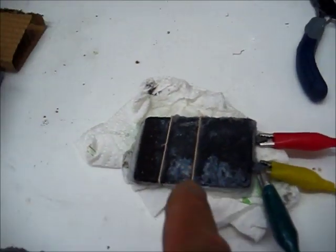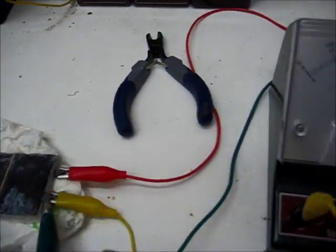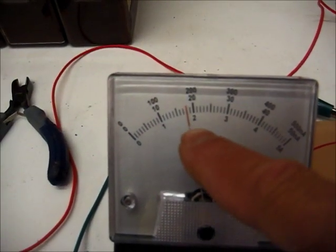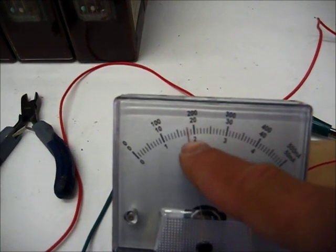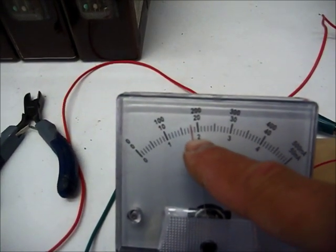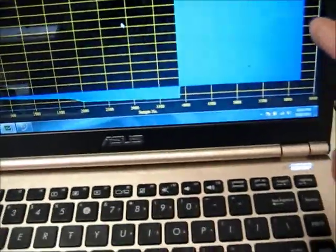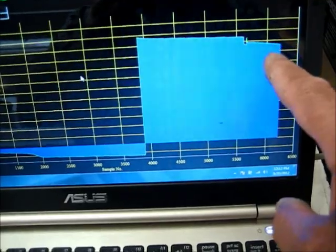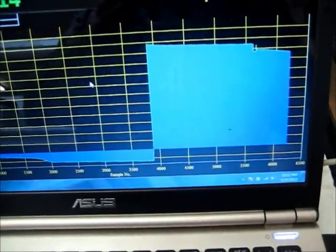Anyway, I want to come back to this real quick. This battery that we made — I showed you in the beginning where it's forming. This is what it's doing — 10-minute charge after the sulfation is driven off. And this is why I'm trying to find a chemical mix that's very safe, that can sustain this power ratio. And this hasn't dropped that much in 20 minutes. But it's going to follow the same crystal curve down. So I'll be back with the other battery as soon as 10 minutes is up.